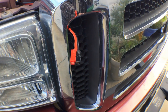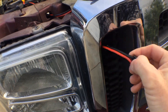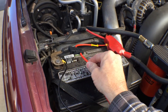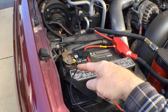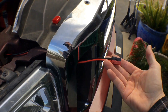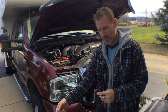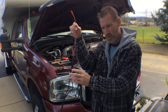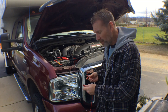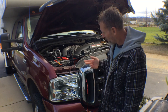You can see that normally this would just fit back in here with the cap on. I can pull that out — the 10-gauge wire runs through. Got my 30-amp fuse and just simple positive-negative wiring out to the Anderson connector. The cool thing about this is I've got my air compressor down on the ground with the modified power cord and Anderson connector on this end. These are locking connectors — there's only one way to hook it up: black to black, red to red. Slide these right in and it locks in place, and now my air compressor is hooked up.